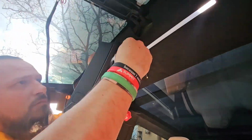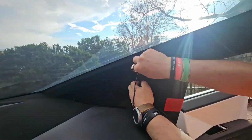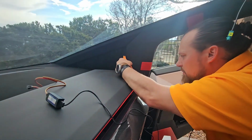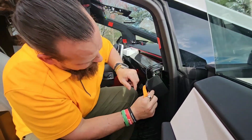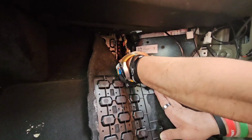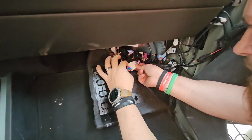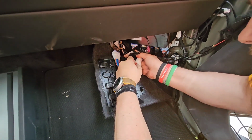So I'm going to go ahead and string these 2 wires across this little section. Again, I pulled this down more than what I think a lot of people do, and that made it a lot easier. As I'm fishing this new cable in all the way down, I'm removing the old one. Again, you can just tuck it back in here behind this felt all the way down. Use that little trim tool to tuck it in here around the corner. This little end cap of the dash comes off if your door is open. Then eventually you open up this dash compartment all the way down to the floorboard and pull back this little section to expose where you're going to actually plug in the brains of your unit. Again, I'll walk this through a bit more in a minute, but once you unplug this, you can connect your new camera.